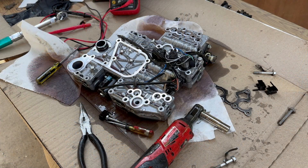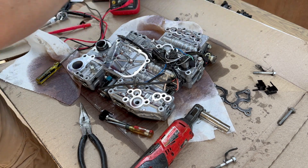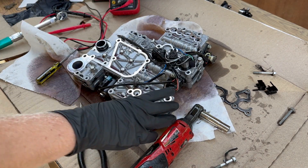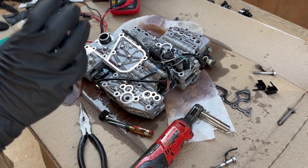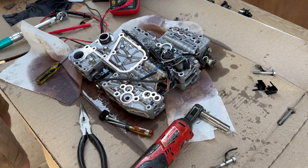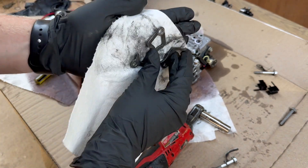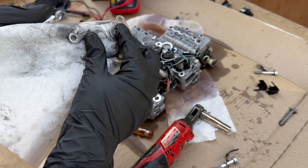Alright, I've got all of these changed out — new covers on, the bad three are lined up there. I believe only this one was bad, but it only went bad when the transmission got warm. I wouldn't have replaced all three, but I had all three, so we're going to start putting everything back together. I'm going to clean this part a little bit — it's got quite a bit of worn metal. Old transmission, not well taken care of.